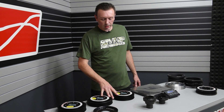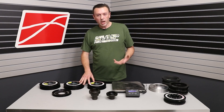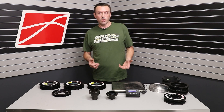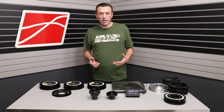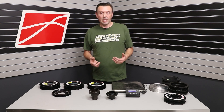These are offerings for the 2020 Shelby GT500 with the 5.2. They are going to add about 2 pounds of boost for the 10% and 4 pounds of boost for the 20%. You can figure that every 5% of overdrive is about one pound of boost — it's also equivalent to about a 0.1-inch change in the upper supercharger pulley. The lower always has to be bigger because it's the drive pulley, and the supercharger pulley has to be smaller because it's the driven pulley.